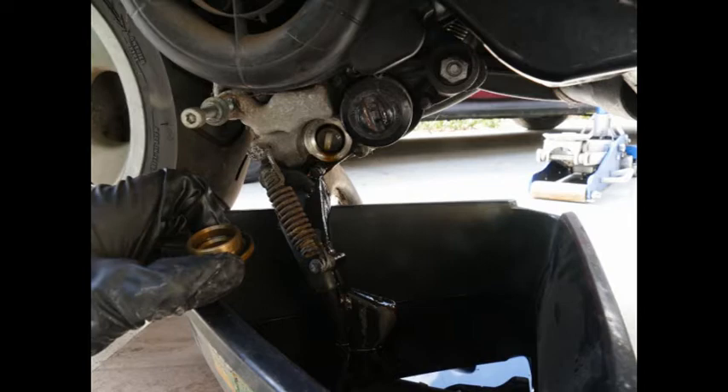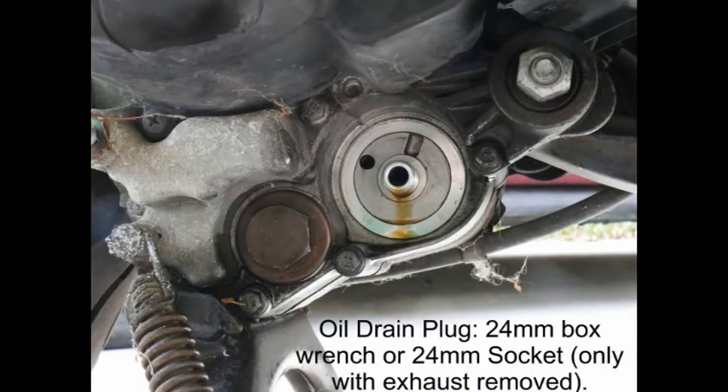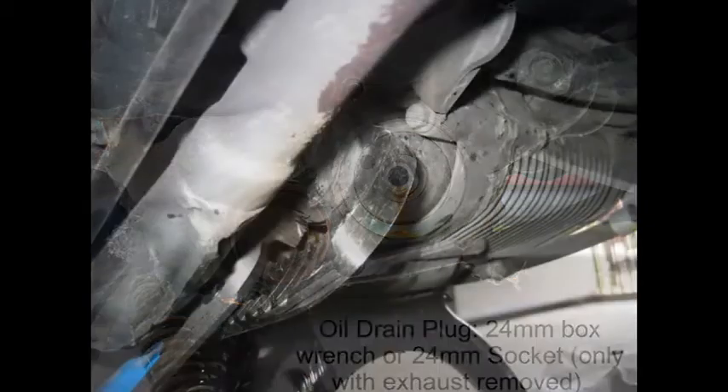It's really difficult to get the 10mm copper exhaust nuts off of the exhaust studs, so I recommend buying two replacement ones. I also found they didn't match standard metric nuts that I had — the thread pitch was different. I applied anti-seize compound to the exhaust studs to prevent them from rusting.